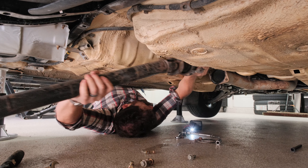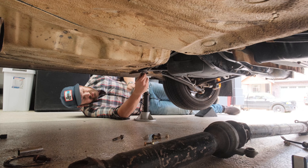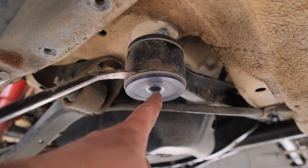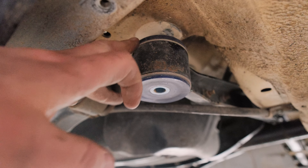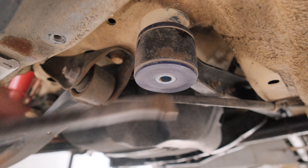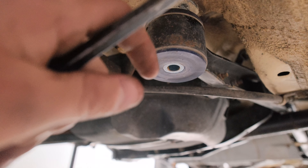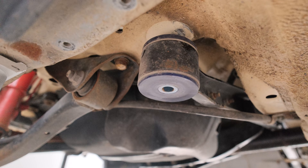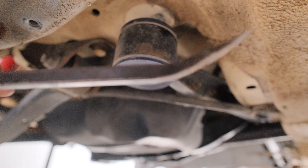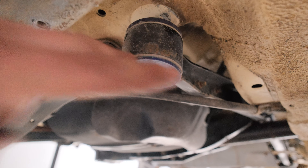Getting the drive shaft out isn't too bad — four bolts on the rear flange, two bolts on the carrier, and it comes right out. I took the mustache bar bushings out and found that they were sitting upside down. These are bushings I've replaced — these are Super Pros. The top side is a lot thicker than the bottom side. What I did on the other side is I pried this bushing out, flipped it to the top side, and even with a washer we took out, it's way shorter than the top bushing because they're just a sandwich bushing that you press in. You can get them out really easily. Swapping these is actually going to rock our pinion angle up just a little bit, and in theory it should help the vibration.